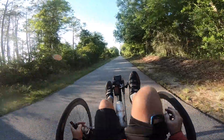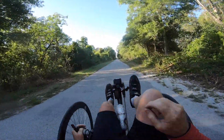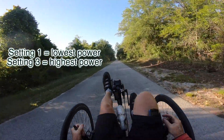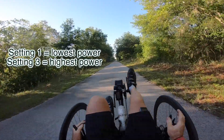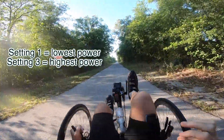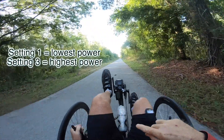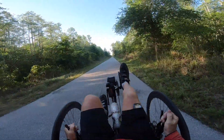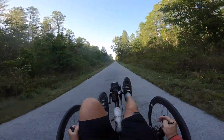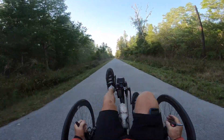Okay, we're out on our trip now. Right now I have the brake lever just barely touched — it has a brake sensor in it, so when you hit the brakes it shuts the motor off, and I've downshifted to a bigger gear for climbing. Let off the brake and it automatically takes off. Now you don't want to shift with the power on or you'll break your chain. They do make a shift sensor that shuts the motor off so you can shift, but the best way I've found is just barely touch your brake and make your shift to your next gear, then when you're ready just let off the brake lever a little bit and pedal. If you're ready for another gear, tap the brake, shift, and let her go — and she'll fly.